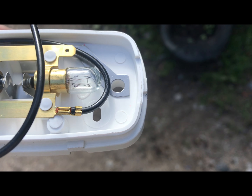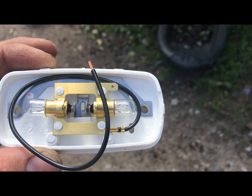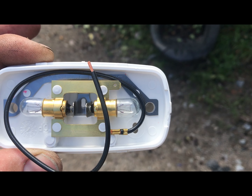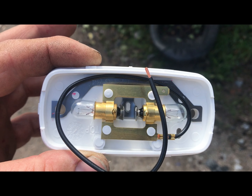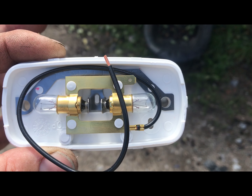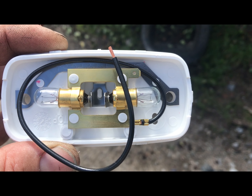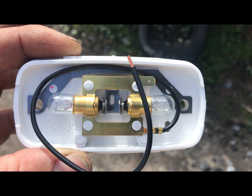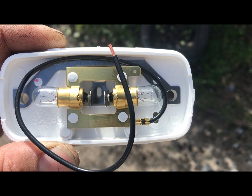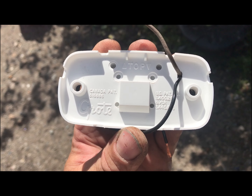This black wire and another wire will feed through there, and then all I have to do is find a live wire and a ground wire when the lights are on. Hook that up and then whenever the lights are on it will turn these lights on. It doesn't matter which way you wire it — as long as the 12 volts is going through it, those lights will come on. Which one you put to the ground and which one you put to the live doesn't matter. And that's where the wires come through the back.